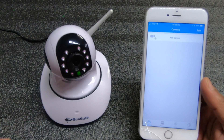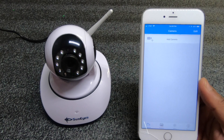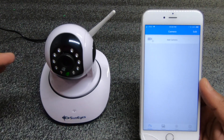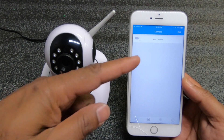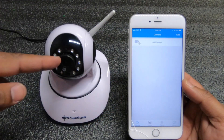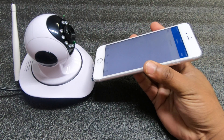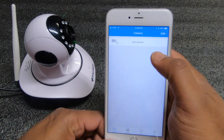Once you get to this screen, go ahead and plug in your IP camera. It's going to do its normal routine — pivot and tilt up and down — and during that it won't be discoverable. Once it does its routine, you'll notice the light is blinking. Make sure you're in a quiet room when you do this. When you add the IP camera, it works off some kind of sonar-type technology. The phone sends a sound to the camera, the camera picks it up, and that's how they link. Make sure your phone is as close to the mic as possible and keep it turned to the side — I found if you just leave it flat it doesn't work as well.